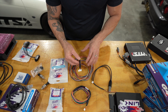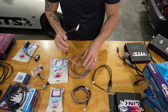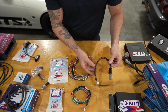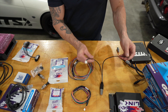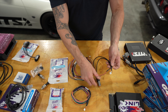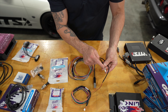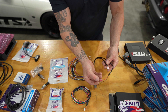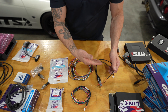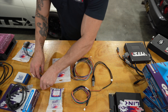They have pre-terminated ends for where they clip into the actual circuit board itself, which is nice and handy. All of them have two harnesses you can attach onto the board, some have three - so three times eight cores, that's a lot of inputs and outputs. Next is the CAN network cable. It plugs into the circuit board and carries CAN high and CAN low, and will have 12 volts and ground also in there as well, getting power from the ECU, which is handy, but not all of them do.